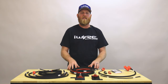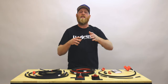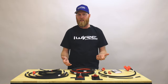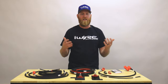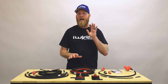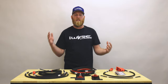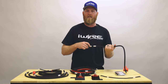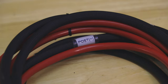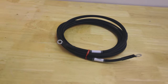We've designed the harness so that you can relocate the battery anywhere in the back. In the initial design, we intended the battery to sit on the passenger side in the trunk toward the tail light, because if you're going to race the car that's the most offset corner from you as the driver. But the cabling is long enough to reach that back corner, which means it's long enough to reach anywhere in the trunk. All you need to do is run the cable from the front to the back of the car and use our pre-labeled cables — all cables have labels indicating where they go and what they attach to — then just follow the directions, bolt in your battery, and you're done.